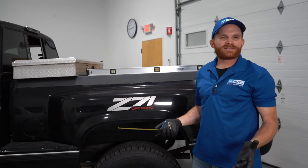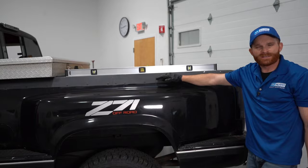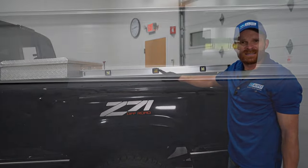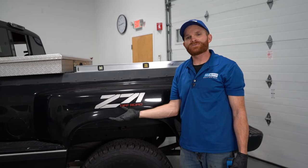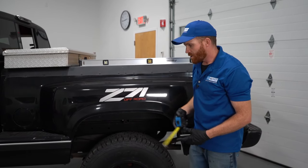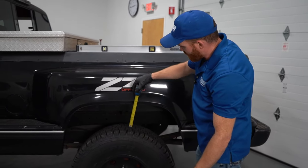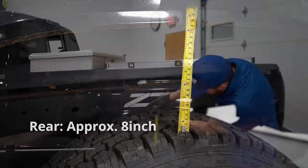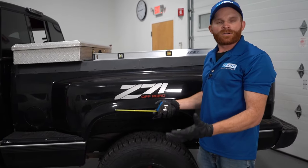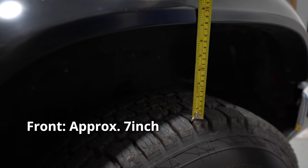A couple of ways to see exactly how much rake you have: you can either use a level coming across the bed, assuming your bed is nice and straight like this one right here. You can tell that this is definitely sitting up much higher in the rear than it is in the front. It's common for it to sit a little bit lower in the front than the rear, but this is an extreme case. Also, you can use a tape measure — everybody's got one of these. If your tires are at pretty much the same tread wear, go from the tire itself up to where the wheel well is, take a measurement on all four corners, write down those measurements, and that'll give you an idea of what your rake is at.